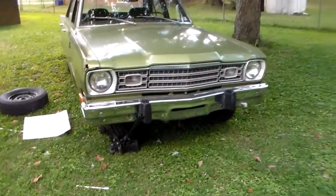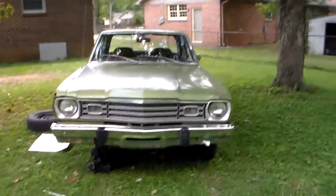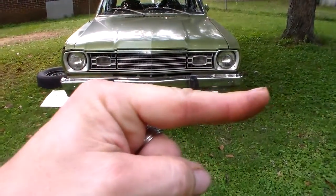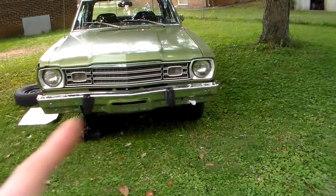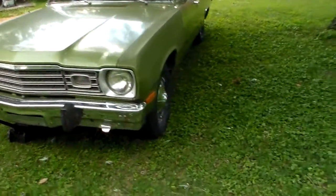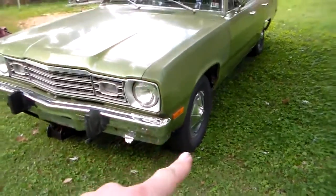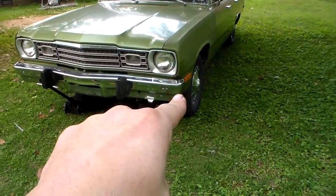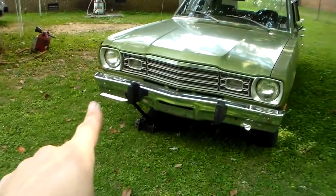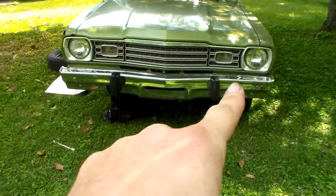What generally happens when you have drum brakes — I will say they are more prone to reacting unusually if you have something going on. But when you have one that's pulling one way or the other, you need to think about what's going on, and people tend to focus on the wrong thing. The first thing they think is it must be that left brake doing something wrong, that wheel's grabbing. Well, yeah, it's grabbing because it's the only one working up here. Normally, the brake that is working and working the best pulls the car in that direction. So if that brake is functioning and that one's not, it's going to go that way. The brake that's working is going to pull the car in that direction. So obviously what we have here, for some reason or another, that brake on this car is working and this one is not.